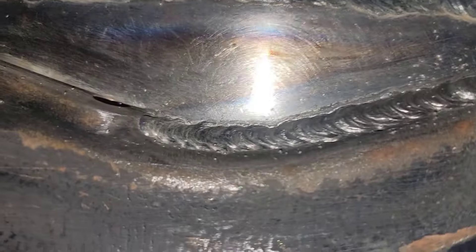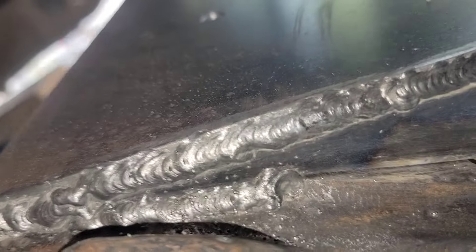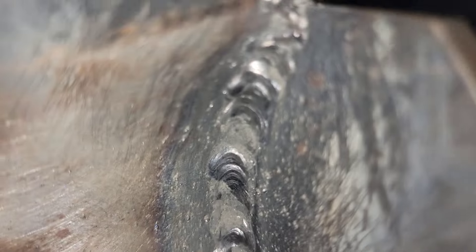With the flash on you can see - I welded this side as well as the inside. I didn't want to weld right on the surface where the threads are for the shock, so I'll come back to that. Some more welds over here - not the prettiest, but strong enough to hold. For the top mounting plate I did the same thing - welded gussets right here and the bottom plate is quarter-inch steel, so it won't bend. It's just extra reinforcement.